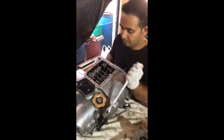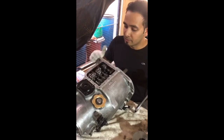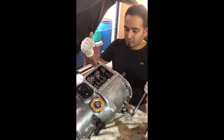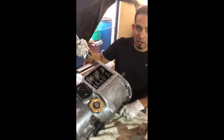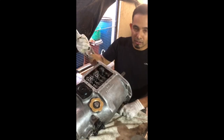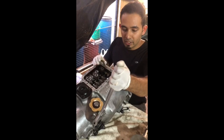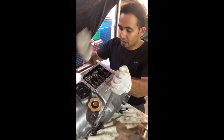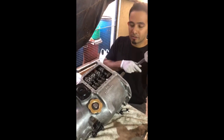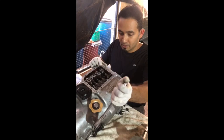Let's say I'm driving along the road and I want to shift into third. My RPMs are going up, so I shift into third on the lever — but the car is still on second and still driving in second. I put my leg on the clutch and just bump it, and as soon as I bump it, it changes into third and then I can accelerate.